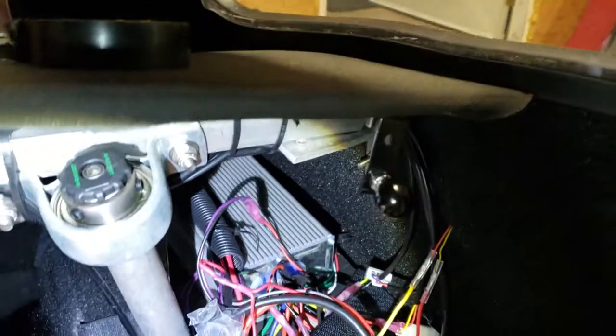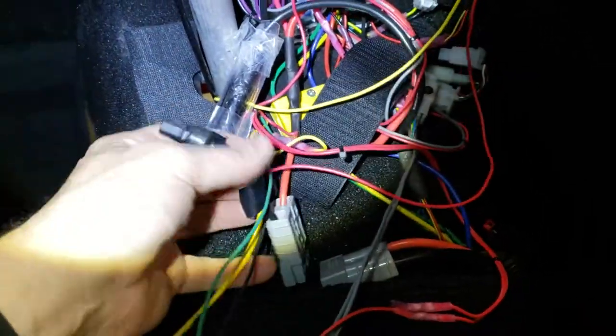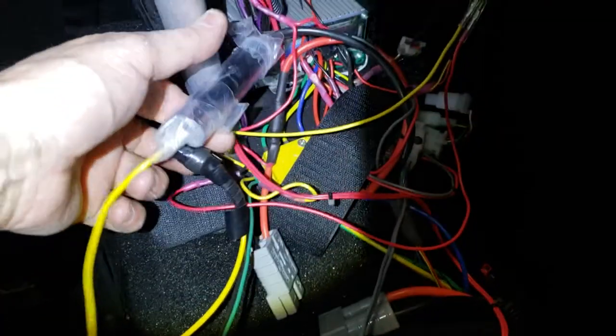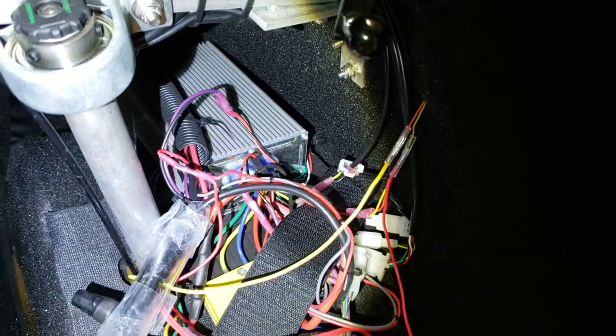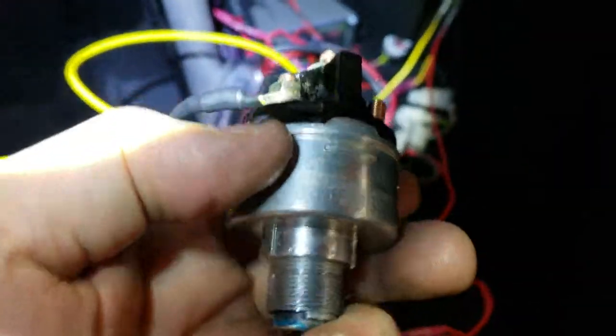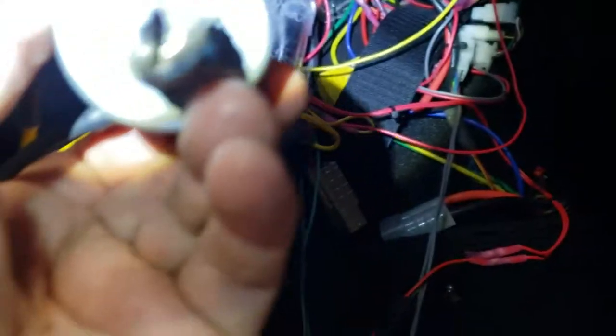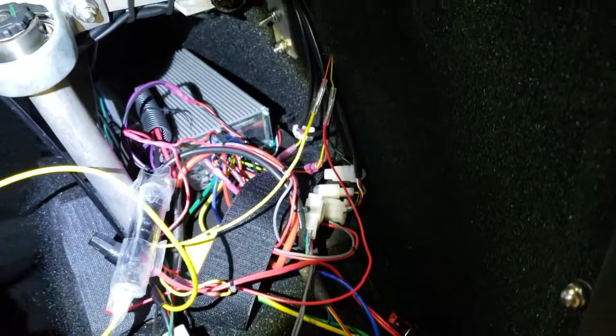So I spliced in a yellow wire from my ignition key onto the Anderson connector, and then all I did was splice in the second wire off my ignition key back onto the other wire part of the Anderson connector. So now when I turn this ignition switch on — I'm not going to do it right now because I'm holding it in my hand and it's metal — but essentially when I turn the key, the ignition switch will connect these two poles, basically joining the Anderson connector to that wire as it was before I cut it. And voila, we have power. When I leave, I turn that switch off, pull out the key, and we have no power.